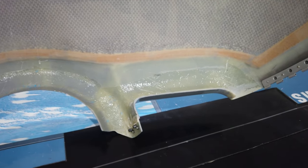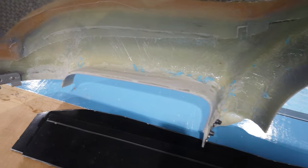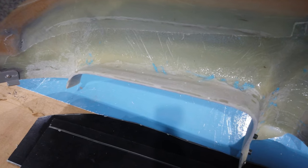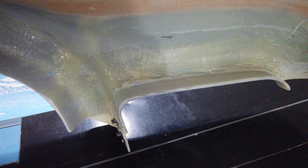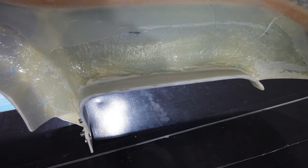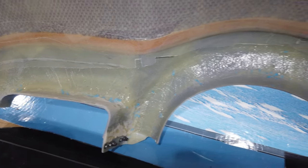Sorry for the camera — trying to do this one-handed as always. Now we're inside the cowling and here's an inlet — you can see how I sanded that smooth. Here's the other side. All I had done was mixed up an epoxy flox mix, nice and thick, and slathered it on both of these like peanut butter on bread. Let it dry for quite a while — actually a couple weeks, though it doesn't need to be that long. Then I came back and sanded them smooth and flat. It adds a little bit of thickness which is good because you're going to run bolts through there anyway.